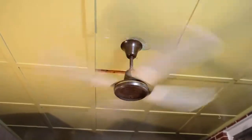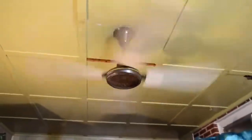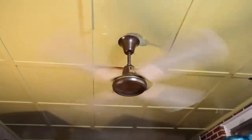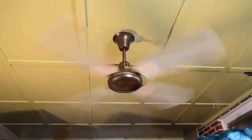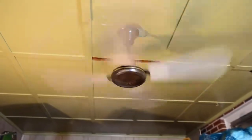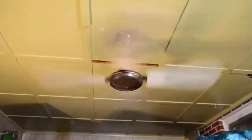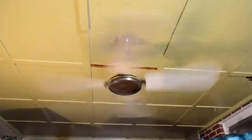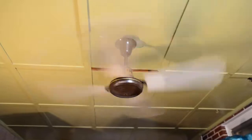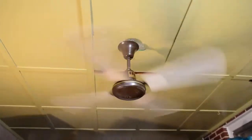This thing is extremely powerful, surprisingly enough, and I think I know why. I think this fan uses the same motor that some 56-inch Golden Fans use — they just put a higher pitch on it to balance things out. Then again, it's kind of weird, because this motor is the same size as other 48-inch View Fan motors — same physical dimensions — and yet the same motor ends up in a 56-inch fan and that still flies, although it gets extremely hot. Other 56-inch View Fans, like the ones with steel blades, use larger motors still. View Fan was a little weird with its sizes.